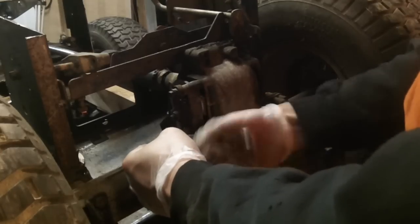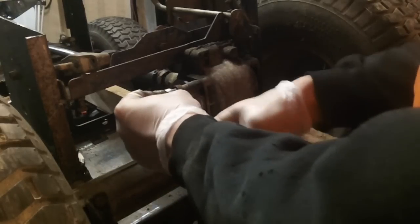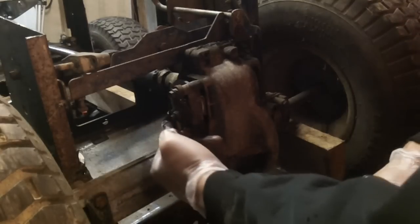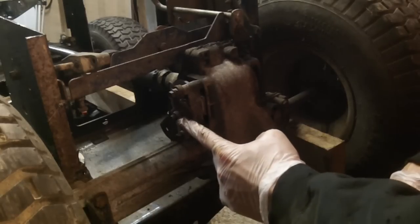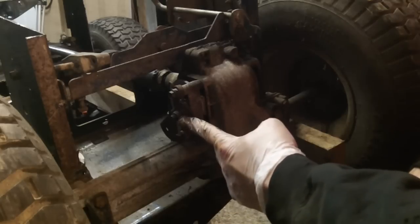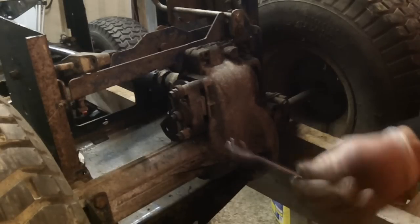Again, you are going into aluminum, so don't over-tighten. From here on out, you've got your spring connection that's on the back up here. As said before, if you tighten this, your brake engages sooner; if you loosen it, it engages later. Have fun guys, thanks for watching, hope you enjoy the rest of my how-to's.